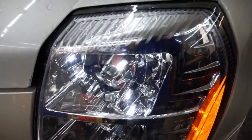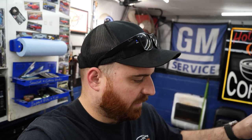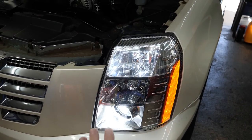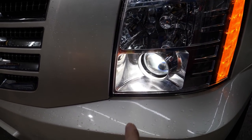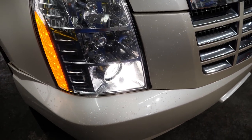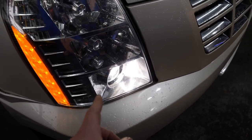So on the driver's side here, we have an LED daytime bulb and an LED high beam. So I am Matt from the future — do not listen to past Matt, because he confused a lot of things. That's the high beam and the low beam. That's the daytime running light. That's the marker light. That's all you need to know. The low beam is working. These may have been swapped out already — I don't know if these are original xenons. They're white; I would think the original lights are more like a halogen color. So it might have LEDs in them already. However, I do hear the classic xenon buzzing noise, so the ballasts are definitely still powered.